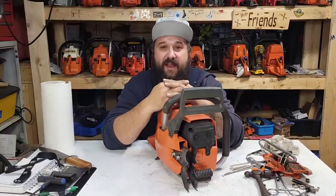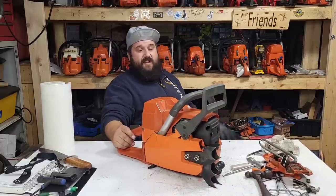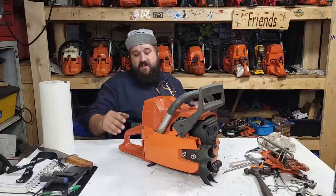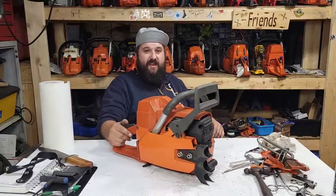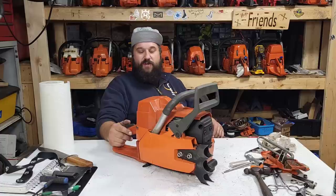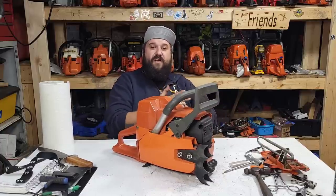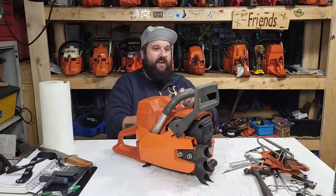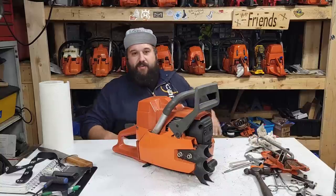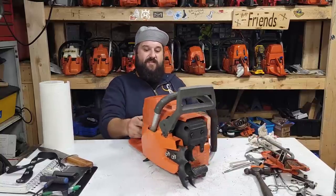He owns that Echo CS590 that, for whatever reason, friends, that saw never made it. It never ran properly. It's still sitting here in a box. Who knows if it'll ever come back out again. I have probably 100 hours into that build and we threw parts at it for a while and then I had to stop and think. For whatever reason, friends, that saw just doesn't clean up in the cut. I've tried numerous carbs, coils, etc. The timing and porting is not any different than any number of saw builders use.